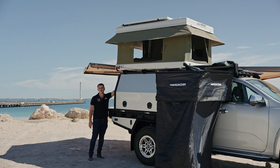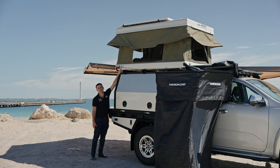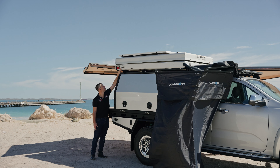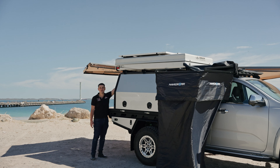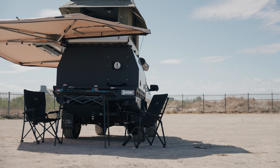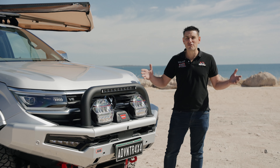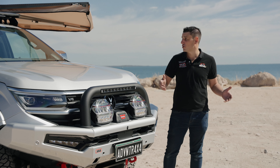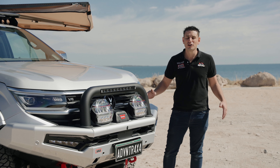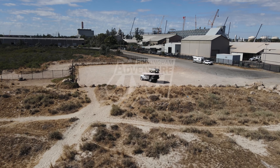On our canopies, rooftop tents are really, really popular and we have a huge range to choose from. We were quite lucky this customer already had his own rooftop tent from his previous Amarok, so we've remounted it for him and put 360 watts of solar on top. That way it's charging his 300 amps of lithium power, so wherever he is he's always got power on board. What's really special about this is it's up and down just with the push of a button — ready to rock and roll to the next destination.